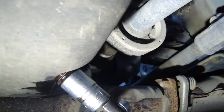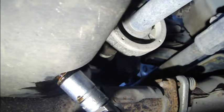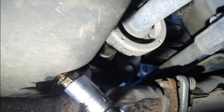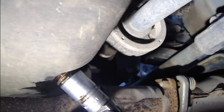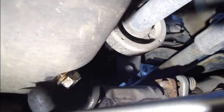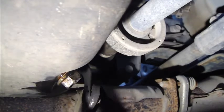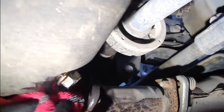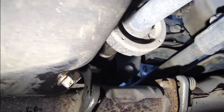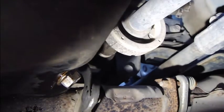I tighten that bolt, and this tightening is something like 50 Newton meters. If you use a tool of something like that size, it is okay. Do not tighten too much, because then the bolt's threads can be destroyed, but something like 50 Newton meter torque is okay. And then we clean this area, and then we go to add more oil.